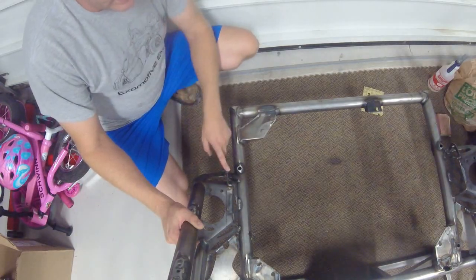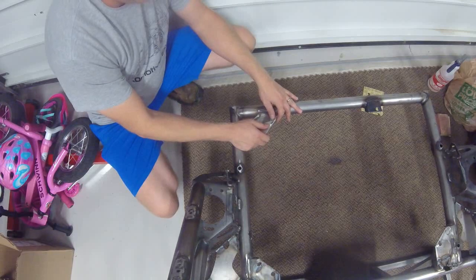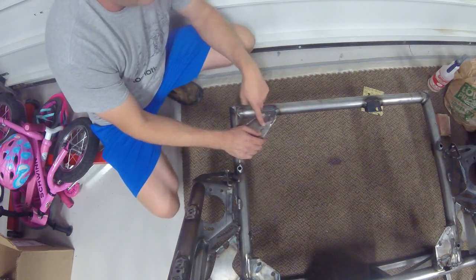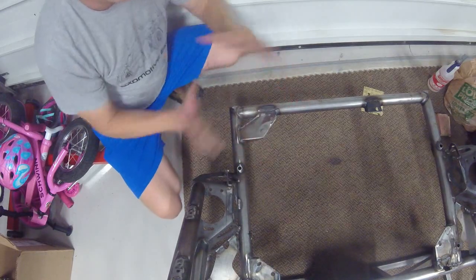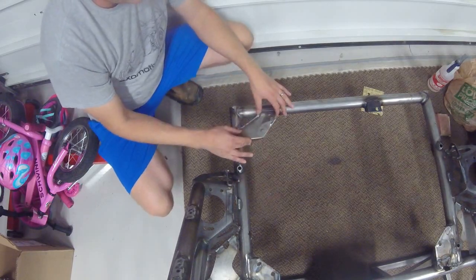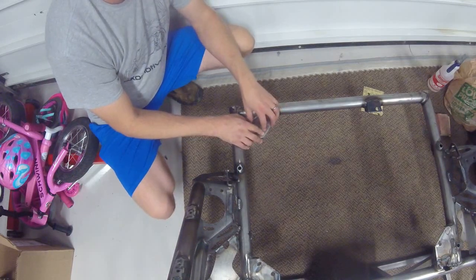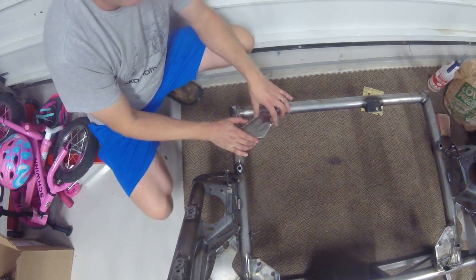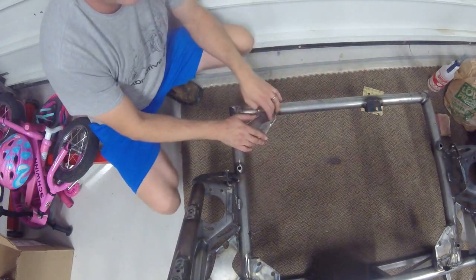In the rear, these are the rear bodywork tabs that I mounted and welded on. Under each of the four gas tank mounts, I went ahead and added a piece of eighth or three-sixteenth inch flat bar — the stock ones are just thin 16 or 18 gauge sheet metal, and every one I've seen after a couple years is bent up, broken, and mangled from the weight of the fuel tank and fuel sloshing around. I cut flat bar and welded it to the tabs and to the tube as well, so there's no flex at all — very solid — which should make the fuel tank mount much more secure long-term.